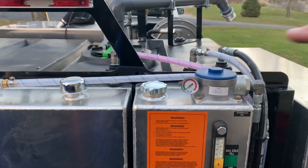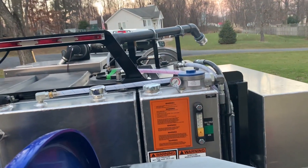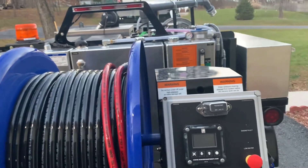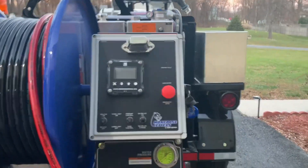You see the middle line there turned pink, so now it's sent antifreeze all the way through the jet hose, all the way back to your tank. Whatever water was in this hose was also pumped back to your main water tank. So there are two lines left.